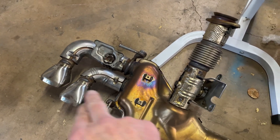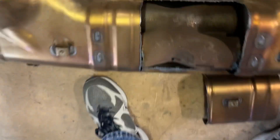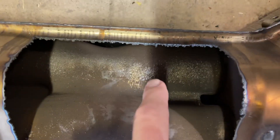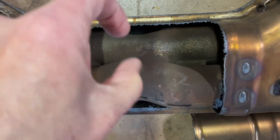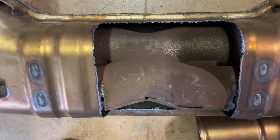These little guys are along for the ride just to be quiet. The thing that's disturbing to me is this X-pipe right here. Not only is it just a cheap stamped piece of metal, but I don't like the fact that exhaust goes this way — they have to mix it together because it's a push-rod V8 in order to get even pulses.